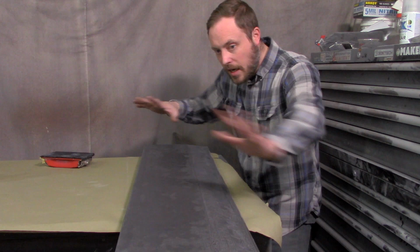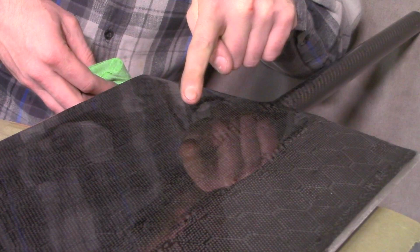Painting time. It's all wet sanded, and the finish is perfect, and it's clean. But I have a pro tip for you. You can't see where I touched it, but the paint is going to have a difficult time laying and sticking, but there is a way that you can tell. There it is. And then in spots that are still oily, you wipe it and the water rolls away from that area. That's how you know you're not done yet, but re-clean it and bam, water break free. It's extremely important for getting a good paint job.